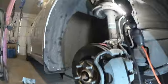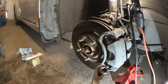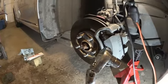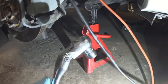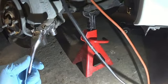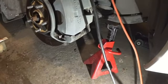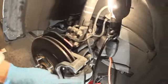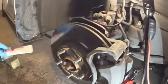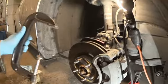Things you're going to need to replace your brake pads on your Lexus: you're going to need a size 14 socket to remove the caliper, a ratchet or wrench — depends what you have. You're also going to need grease for the pins, to lubricate the pins, and a C-clamp.